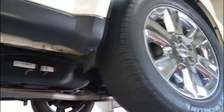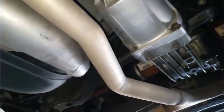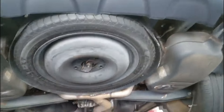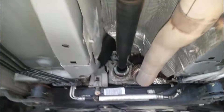The front tires are totally different from the rear. Ladies and gentlemen, that is a no-no. You cannot do that in an all-wheel drive unit. This brand new viscous coupling that I just replaced about a month ago is ruined. It's normally used to link the rear wheels to the front wheels so that when one set of wheels starts to slip, torque will be transferred to the other set. All four tires have to match — you will ruin your suspension and drivetrain driving around in an all-wheel drive vehicle with mismatched tires.